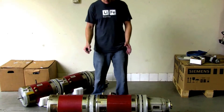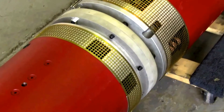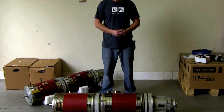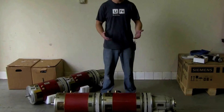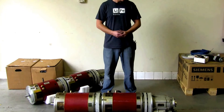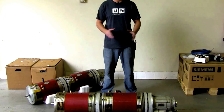We have two 11-inch motors capable of 1,000 to 1,200 foot-pounds of torque between the two of them, and you can expect 400 to 600 horsepower depending on voltage sag. Overall length of the whole package is 54 inches, with the two-speed PowerGlide on the back. You can get this in a 1.76 or 1.82 first gear ratio, and second gear is direct — one-to-one straight through. The PowerGlide is more than capable of handling any torque these motors put out, and it also has park, which is really important with electric cars since these motors freewheel and the car would just roll downhill otherwise. You can use your e-brake as a backup. It also has reverse, which is a big deal with DC motors — reversing contactors to get motors to spin in reverse is complex, so having a transmission with reverse drastically simplifies the conversion.